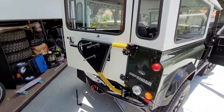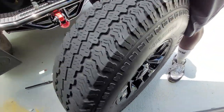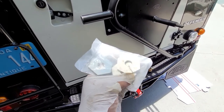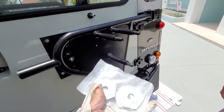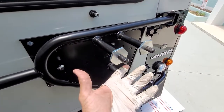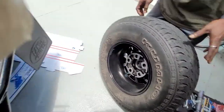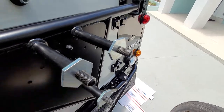Now I'm going to put on the tire. One thing I forgot — when I went to put this other rim on, the tire was hitting this area here. Well, the kit comes with these three hexagon spacers, so we'll be putting them on there and that'll give you a little more space. These are threaded — at first I thought they just popped on, but they thread on. They give you just the right amount of space to fit a sawtooth rim or any rim with a tire that might hit, and you still have plenty of thread to put in your nuts.